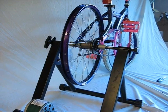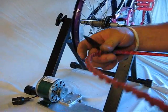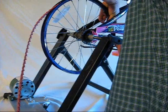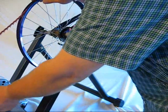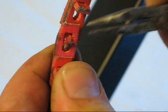Now it's time to put the belt on. The belt is going to go around the rear wheel all the way down to the generator here. This is called a power twist v-belt — it's an adjustable-length v-belt. You can see that the tabs of the belt are facing downward, which means while the person is pedaling it will catch the belt and help it have better traction. Put the belt around the wheel and wrap it around the pulley down here. Take your general measurement of how many links you need. Break the belt using needle-nose pliers — turn it sideways and take the tab off.